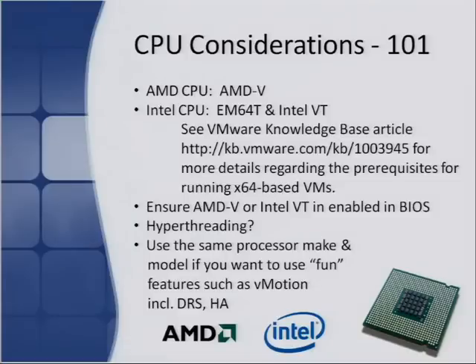What makes up a server? For CPU considerations, you've basically got two choices — AMD or Intel. One thing to say: if you've got a preference, try to stick to it if possible. You may think initially you just want to run one lab server, but once you get a taste for it, guaranteed you'll want to add another server and start using fun features like fault tolerance and DRS. If you've got one Intel server and one AMD server, that's not going to work, so make that decision — AMD or Intel — sooner rather than later.